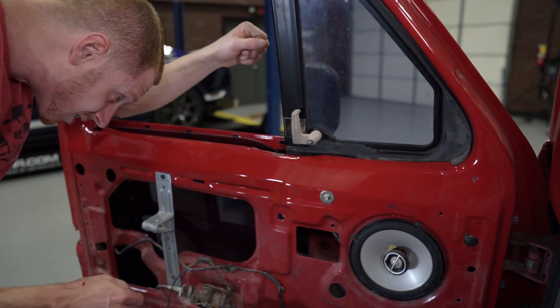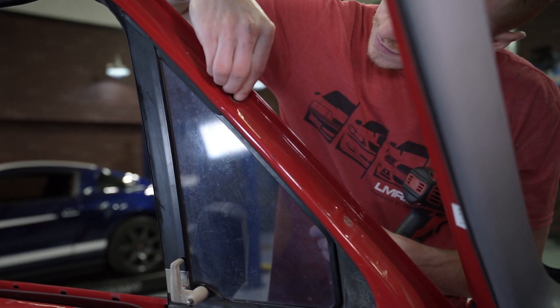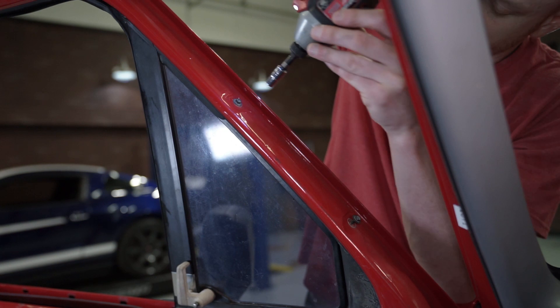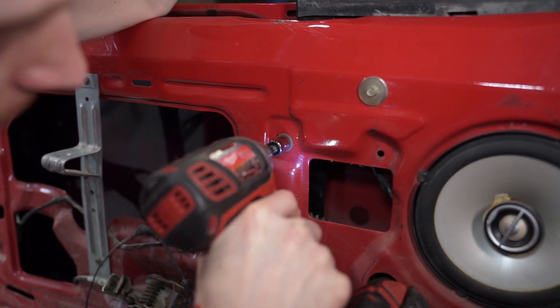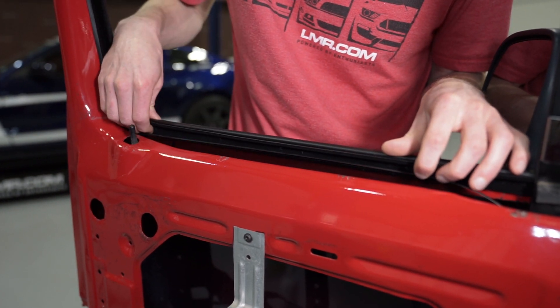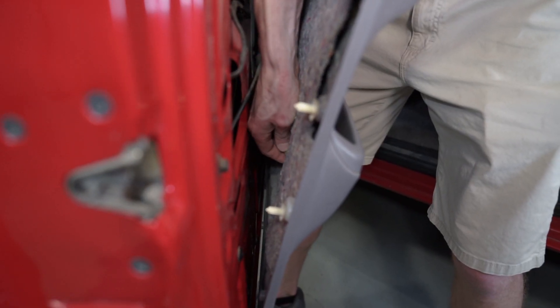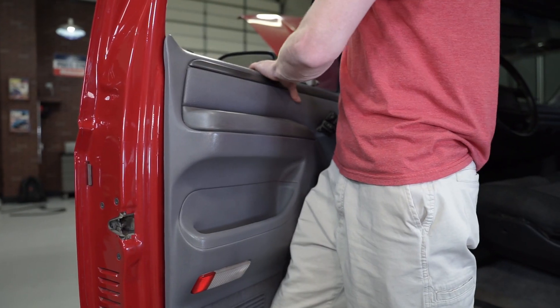Align the bolt hole in the middle of the door. Snug down the 11-millimeter bolt, but do not fully tighten. Align the top bolt holes and finger tighten the 7-millimeter bolts. Ensure that the vent window assembly is properly aligned and then you can fully tighten the hardware. Reinstall the outer door belt. Position the door panel into place and pass the electrical connections through the opening. Reconnect the courtesy light and rotate clockwise. Bring the door handle up and pass the door panel over the handle.